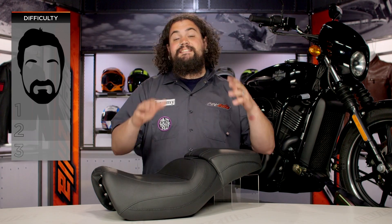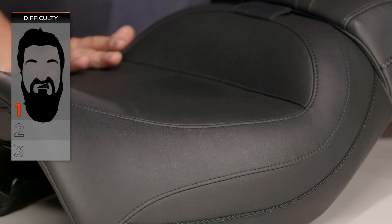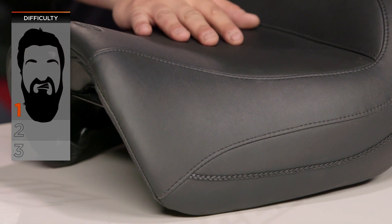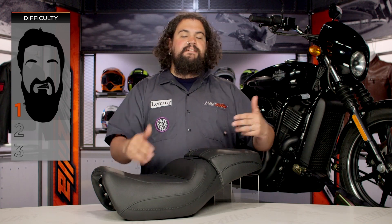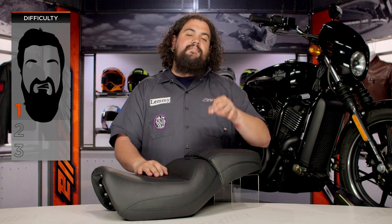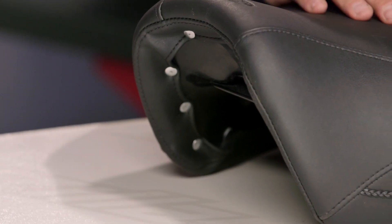Installation on these things is not bad at all. The Harley Street uses just one fastener at the rear of the seat like all the other Harley models. Things are a little bit backwards on it though, because you do have the tab actually on the frame rather than on the seat itself, but it's still very similar to other Harley seat installs if you've done one before. If not, one tool and you should be out on the road in 10-15 minutes — anybody should be able to do this no problem.